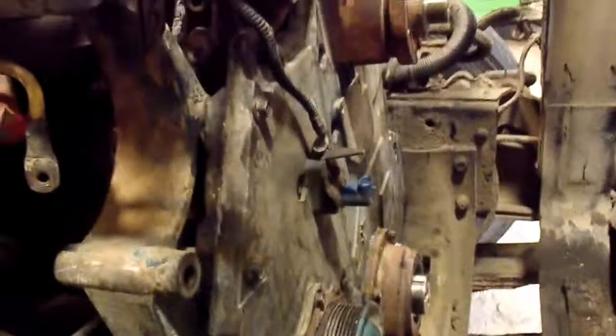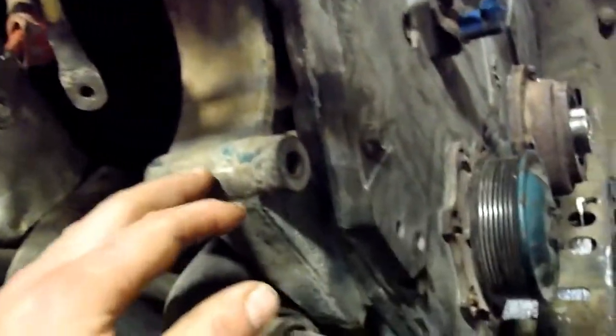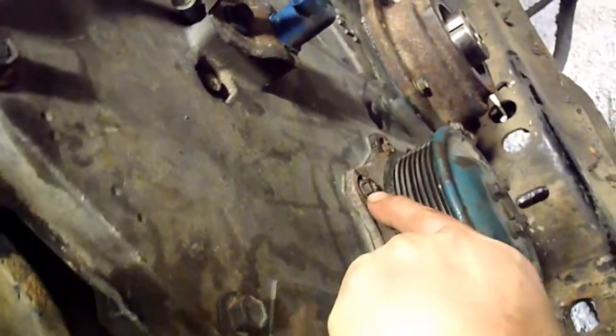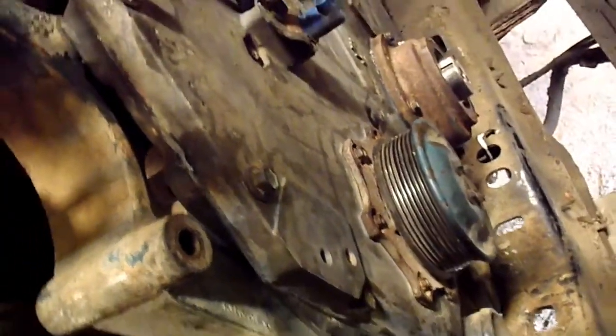I got the cover back on, bolts are all in. So remember a couple things. This bolt goes right through. There it goes through and holds on your alternator bracket. And also this bolt has a 10mm head here on your water pump. It also goes right through and has a nut on the other side. So maybe if you, like, I accidentally put that with the oil pump and couldn't figure out which hole it's supposed to belong to. So anyways, just keep track of things, because it can cause you a bit of anxiety wondering where it went.